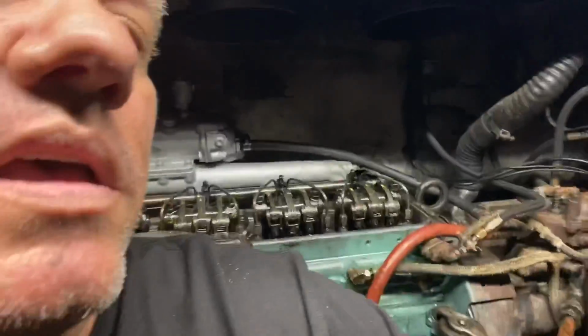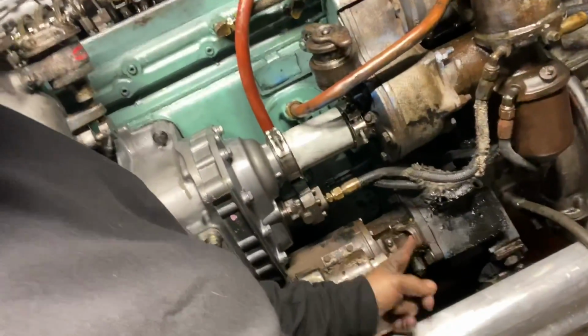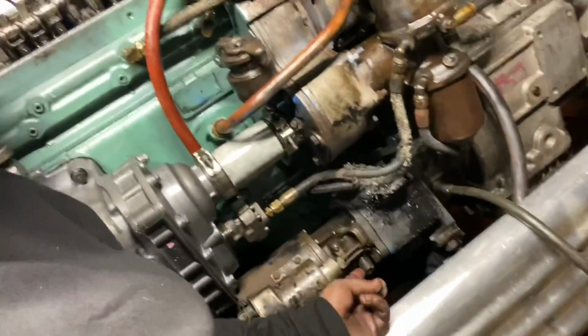This one, we still got a little issue. It's not returning. It's a Dyer drive. The solenoid doesn't return it, and this actually isn't returning on its own. So I think it's the spring that's bad here. So we're going to replace that spring and then go change that. But anyways, we're getting there. It's a heck of a day. I got that shower of diesel fuel this morning. It was just a crazy, crazy day. But it is running, and we're getting much, much closer.